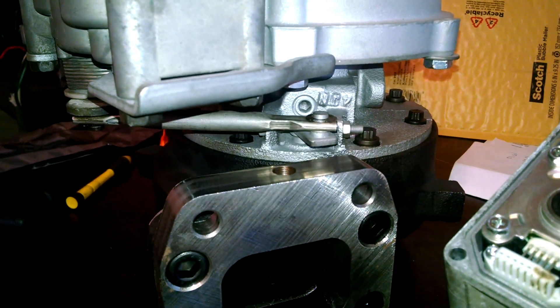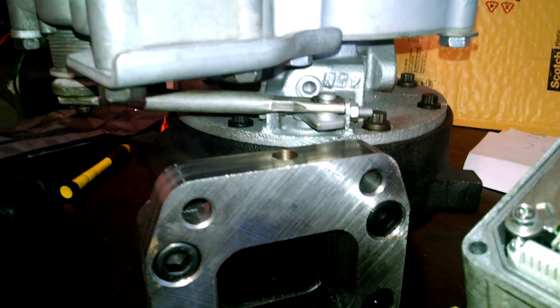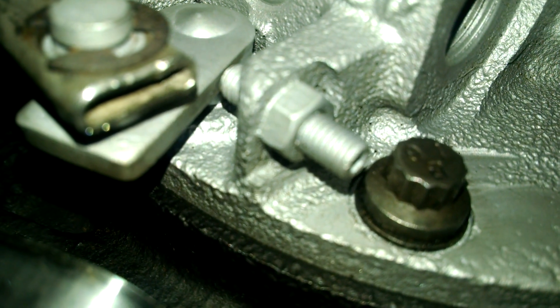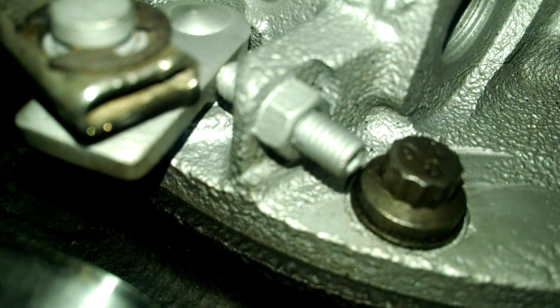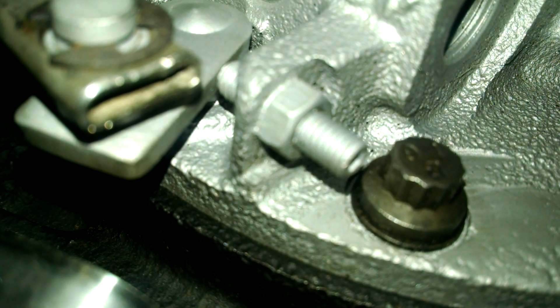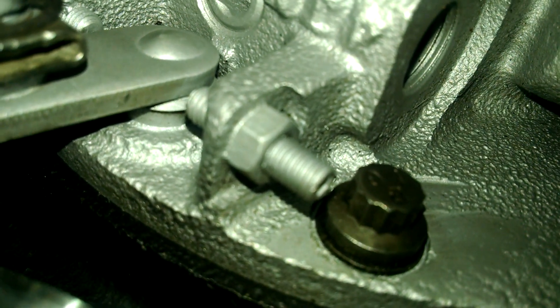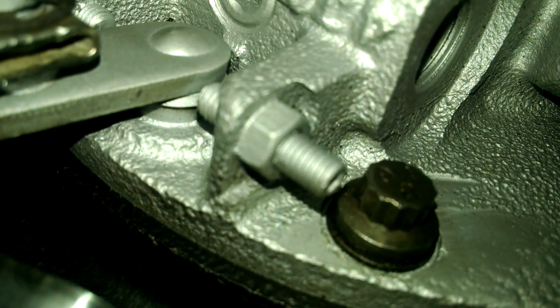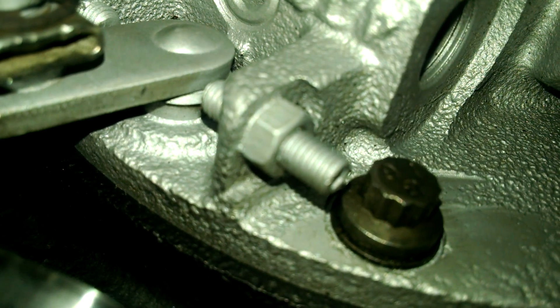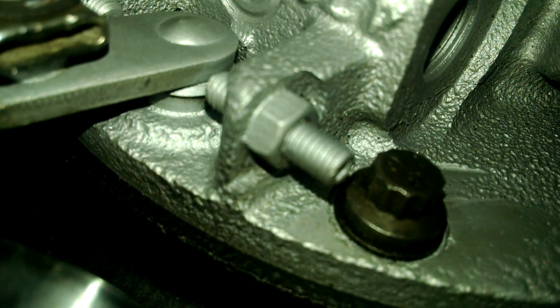Then when you rebuild it again, you can just tell it to actuate, it'll calibrate, and it checks max and sets the right limits. And just to show you — see how close it is? It's right up against it. Now if I readjust that and do this again, and I want it to go to a different position, if I tell it to go to max travel — like 100% travel — it's going to stop right here. But if I recalibrate it again and adjust that screw, it's going to go to the new adjustment.